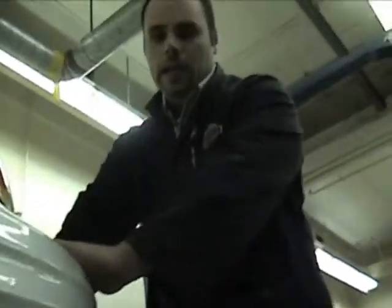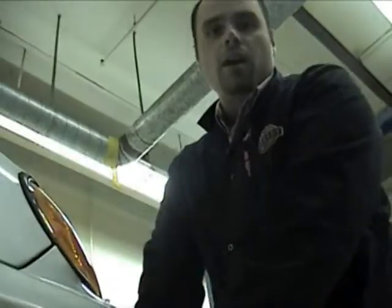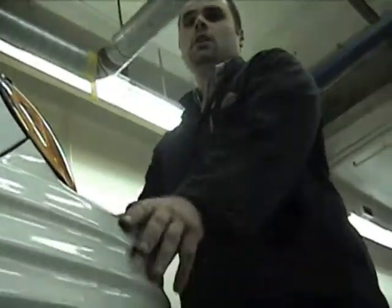The vehicle is resting on the safety stands now. Before I continue, I want to make sure it's safe — I want to grab the bumper and move it up and down and shake it left and right. If it falls, I want it to fall before I get underneath the vehicle. It seems pretty secure, so now I'm going to bring the hydraulic floor jack to the back.